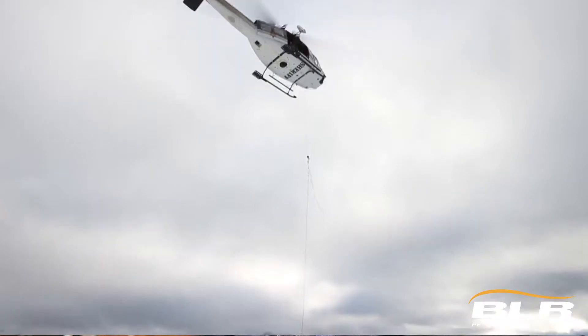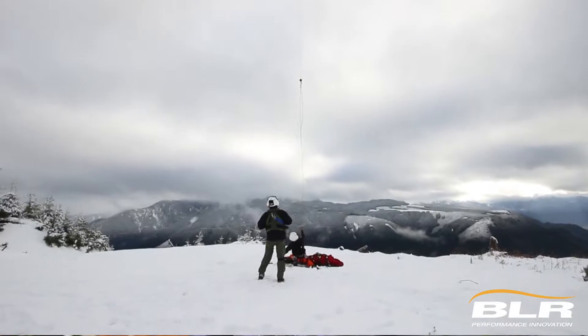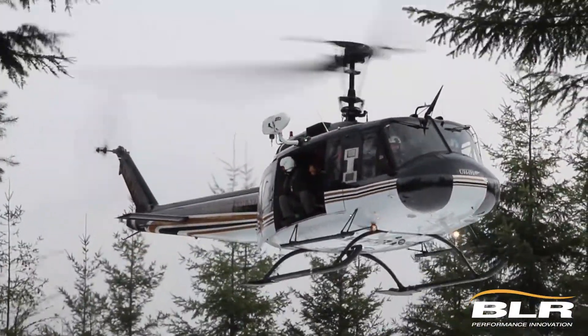That's how much of a difference the strakes make. Once you fly this aircraft without the strakes and then fly it with the strakes, you will notice a huge difference. In the military we had a technique we called the Huey Shuffle. This was something we taught our students and did every time we took off in the Huey. The Huey Shuffle is when you're taking off, increasing power, and adding left pedal to counteract the torque effect and the downwash and wind effect on the tail boom — adding that left pedal, taking it out, adding it back in as you go through translational lift.